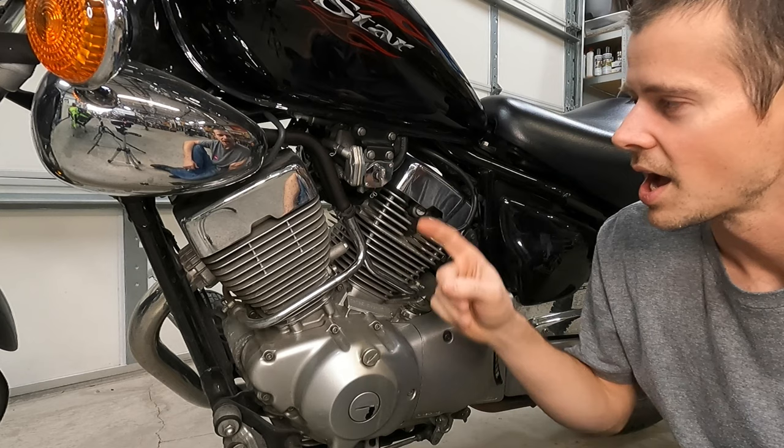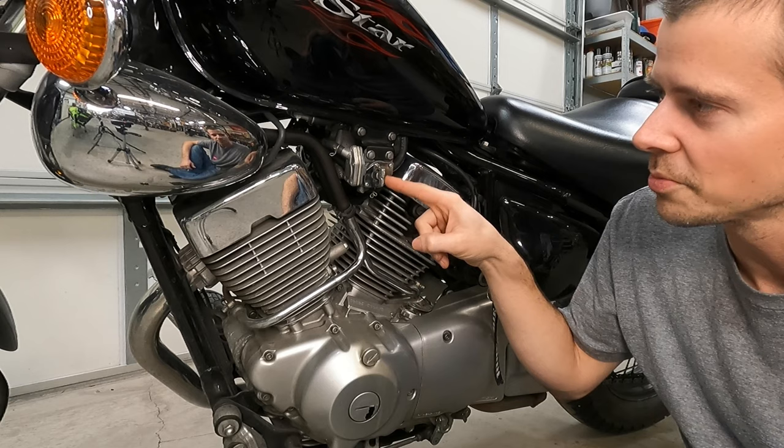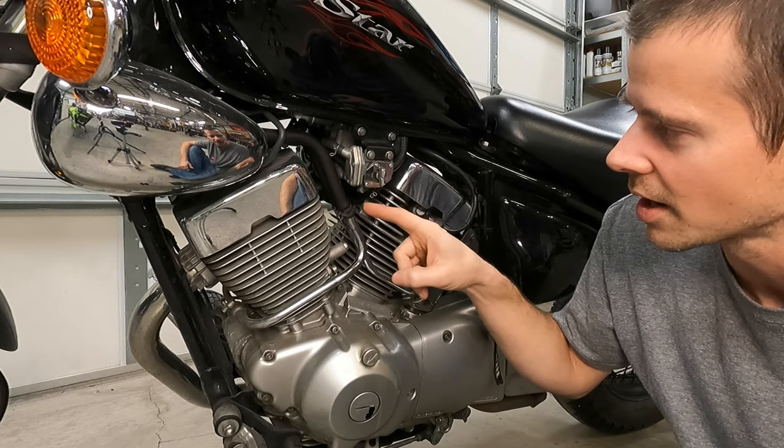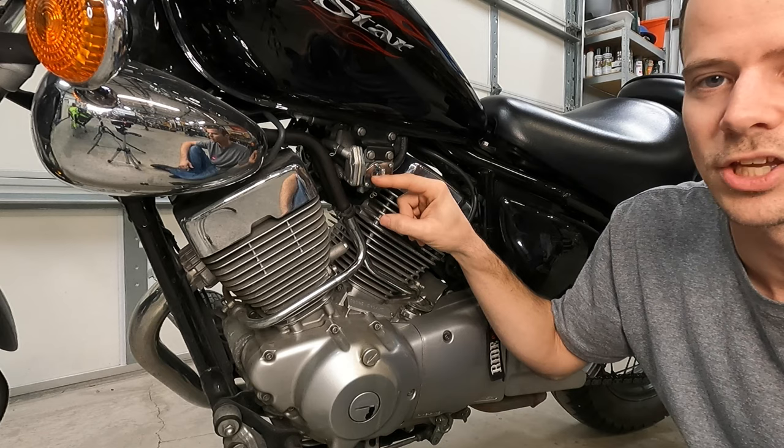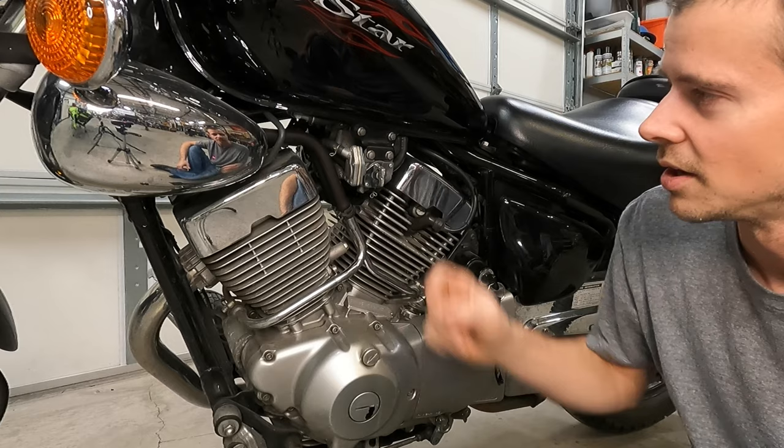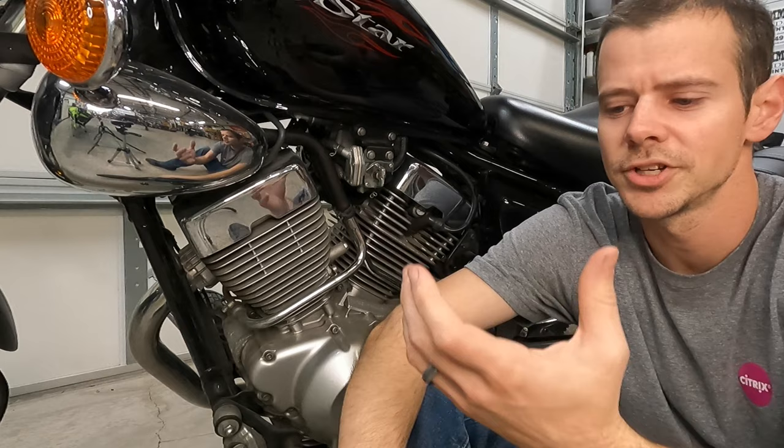So I have a suspicion that it's clogged — the on line is clogged. It could either be that or it could be a vacuum leak. This is a vacuum-assisted petcock, so when it's on, the fuel is only flowing when the bike is on because there's a vacuum applied. If you turn it to prime, that means: I don't care if there's vacuum or not, just go ahead and run some fuel through it. And then you've got reserve, which means suck from the lower straw.